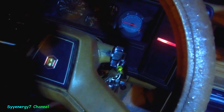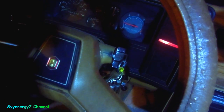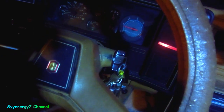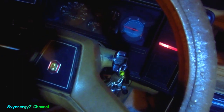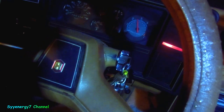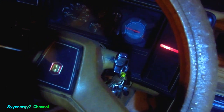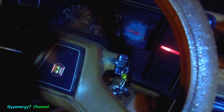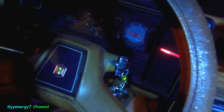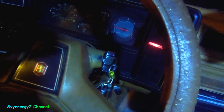That's why you don't start it up — you let it sit a long time. It gets down in the carb. Keep the throttle open, make sure the choke is open, get it down in there. Engine's ice cold, idling around 850. No choke — now it's warm. If I did that with carb cleaner it wouldn't work.